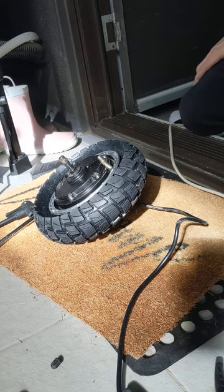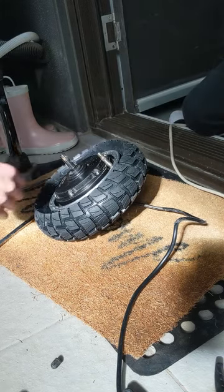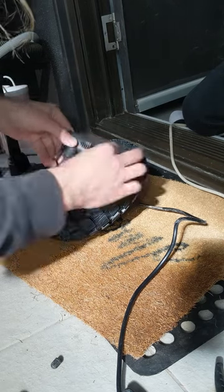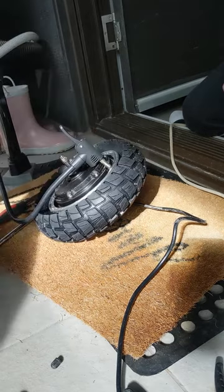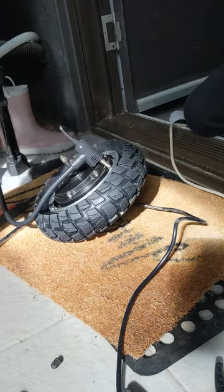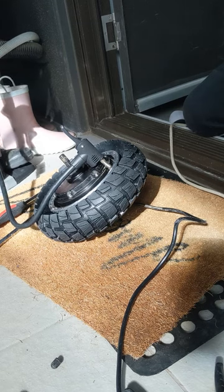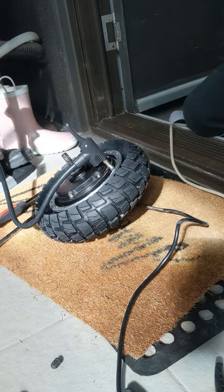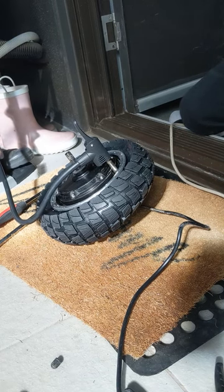Done. We are ready to throw some air and inflate that tube. We're just going to keep pumping until our tire seats its bead on the rim. I'll show you when that happens — we'll have a nice satisfying pop.